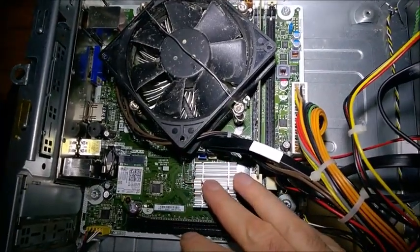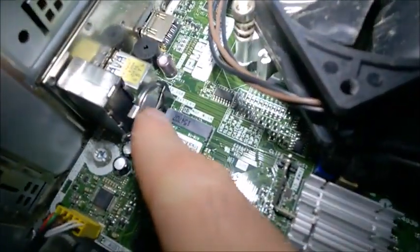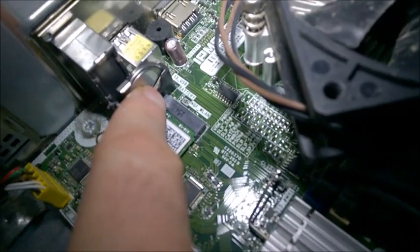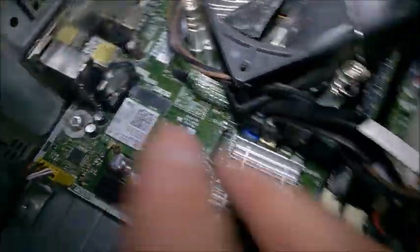If you have an old computer that won't start, the first thing to do is locate and replace the small cell button battery. This one may just drain after a while. Usually it's a CR2032, and it may be on the board — mine is vertical.